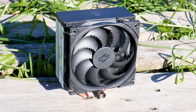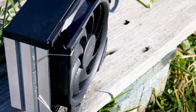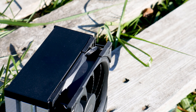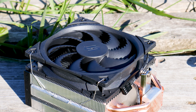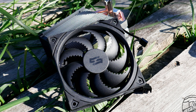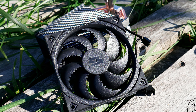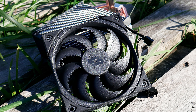The Ferra 5 uses a single 120mm fan for its active cooling. This is a SilentiumPC Fluctus 120, which has a maximum speed of 1,800 RPM and a minimum speed of 300 RPM. This fan also has no less than nine impellers with a curved design. This type of impeller shape is great for static pressure because this angle of the impellers offers good coverage of the area inside the fan frame, hence delivering more static pressure inside the heatsink.